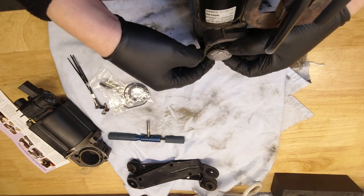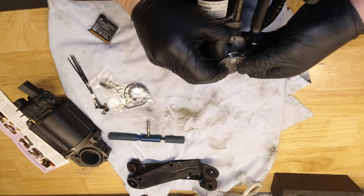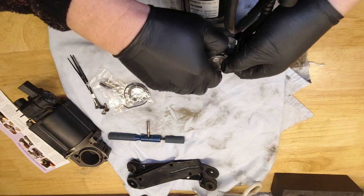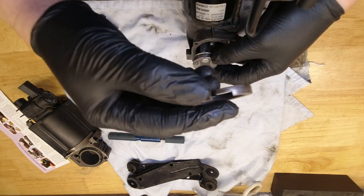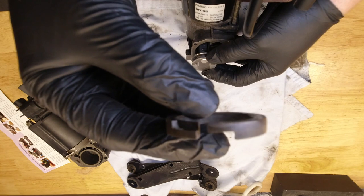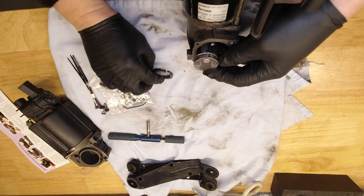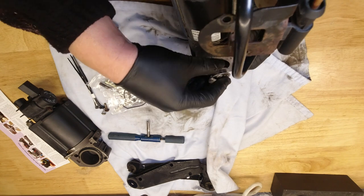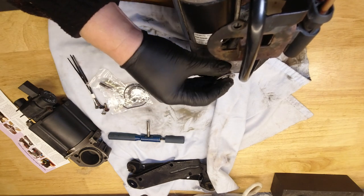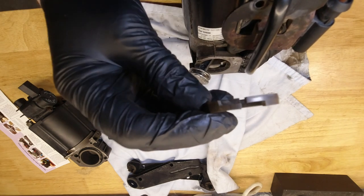So you remove this just by stretching it over the end of the piston. There we go. And there it is. So the right orientation is that the right angle sits next to the roll pin, and the radius does not. See a little piston action there if I work it, but no gudgeon pin at the top, so this changes angle as it goes up and down, hence this thing has got kind of a radiused edge.